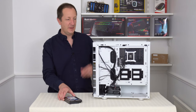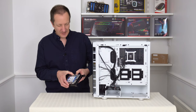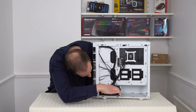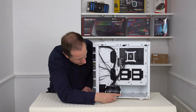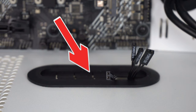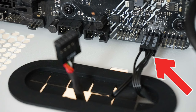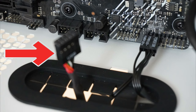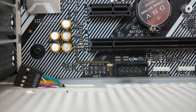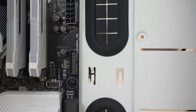Now we can install the hard disk drive into the back of the computer case just here. So let's take out this bottom tray, install the hard drive into the bracket, then put it back into the case. So I've taken the front panel connectors and pulled them through this hole just here. These need to be plugged into the motherboard on the pins on the right bottom corner. The reset switch can be plugged in just below the power switch. Take the USB cable from the back of the case, pull it through the same hole, then plug it into the motherboard just here. Now find the cable marked audio from the back of the case, thread it through the hole, and plug it in on the motherboard. Now find the USB connector and plug it in just here on the motherboard next to the memory.